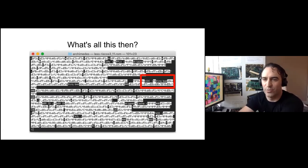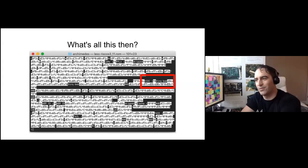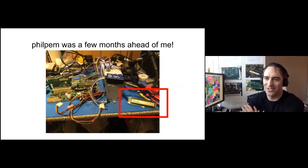I pulled the ROM open in a text editor and noticed the word 'self-test' followed by a whole lot of useful-looking error messages. I scrolled through looking for something Googleable, eventually found 'IRQ bad', threw that into Google, and got the A540 service manual. It's not in the A5000 or A3000 service manuals, but in the A540 all the details are there. There was a mention of a 'debug display interface' with a post test interface adapter. I thought this was too good to be true, but also that probably someone else knew about it. So I Googled it on Stardot, and it turns out this had indeed happened. Around July 2019, while my A5000 was sitting on the shelf, Phil Pemberton had rediscovered the self-test code and implemented the debug adapter side of the self-test protocol, enough to get a target machine to output the detailed self-test output to an LCD.